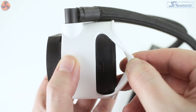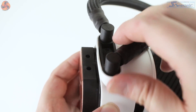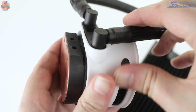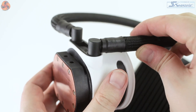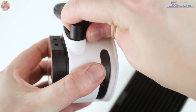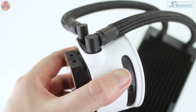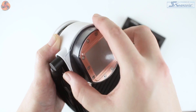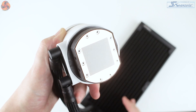Taking a look around the outside, we find the small mini USB port for the power cable. One small criticism I came across with the CPU block is the rotary connections for the tubing. With the Antec Mercury 240 RGB, I found these connections to be almost rock solid in the sense that they would barely turn at all — a little bit worrying, as when trying to get them to turn I found I was putting so much pressure that I was actually concerned I would snap them or break something. After a couple of rotations they did loosen up a little bit though. It is worth noting that thermal compound is included and pre-applied, but as usual this was removed to ensure consistency with our testing.